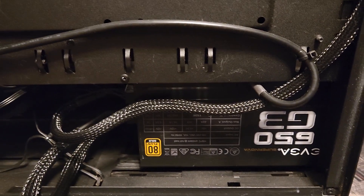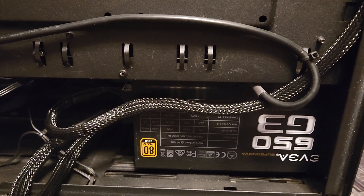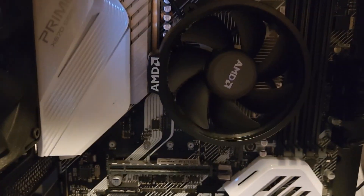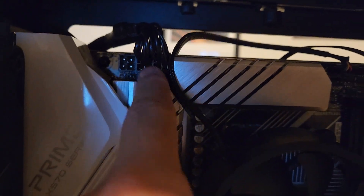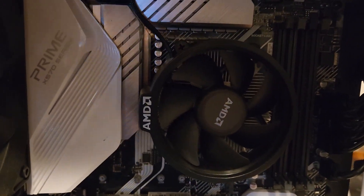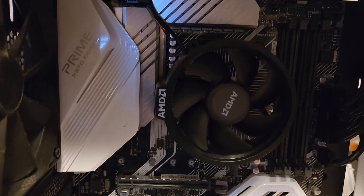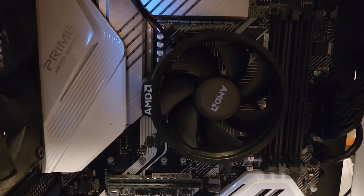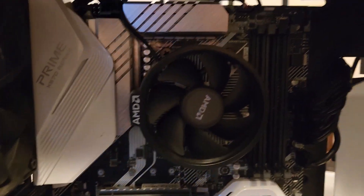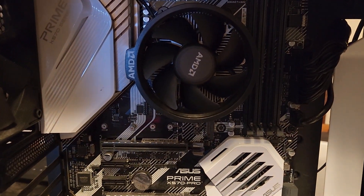With the graphics card we're using I didn't feel it was necessary to get anything bigger. With the CPU we're using as well — even taking the upgrade path into consideration — we won't need to fill the third 4-pin connector, as we're never going to overclock this thing. The next upgrade path would be either a 5800X 3D if you wanted to leave the budget space, or a 5600X. So 650 watts is fine — I doubt you'll need to go higher. The GPU is an RX 6800, basically somewhere between a 3070 and a 3080.